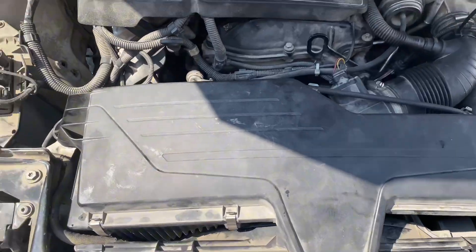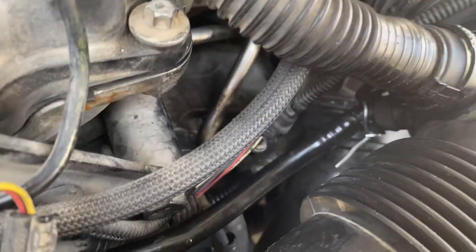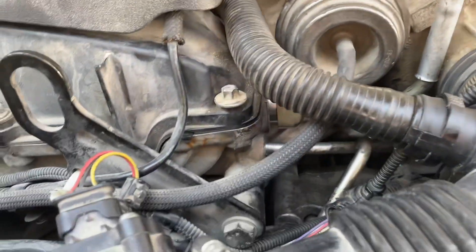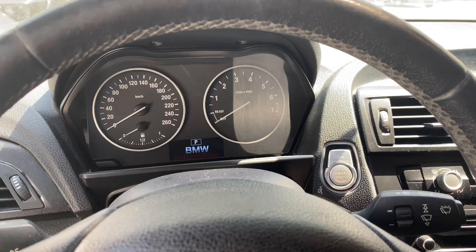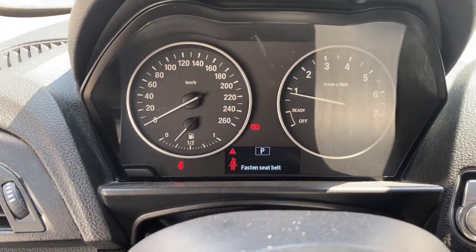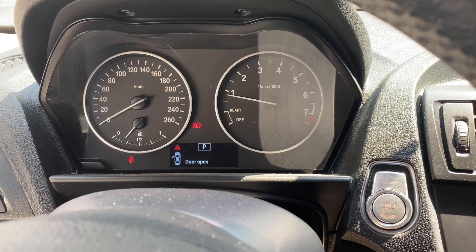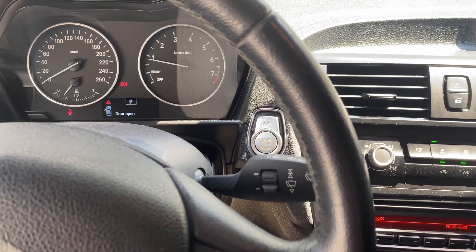The rest is easy — put the air filter and hoses back. Mine has a broken oil return line so I just used a wire. Make sure the bonnet release cable is connected from the top. I cleared the codes and started the car without calibrating anything. The car starts normally, no more drivetrain issues, and the idling is perfect. If this helped someone, hit a like, and make sure you have an OBD reader.